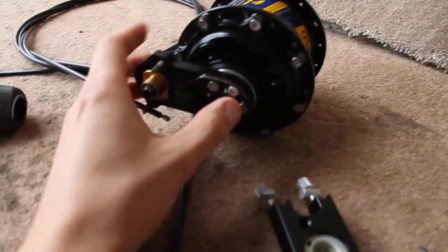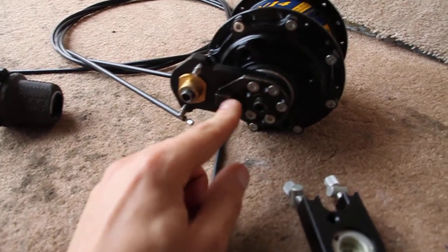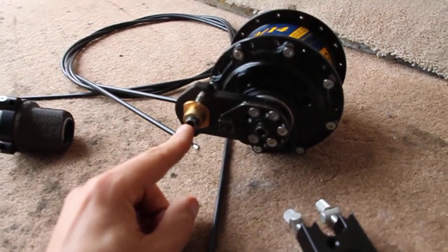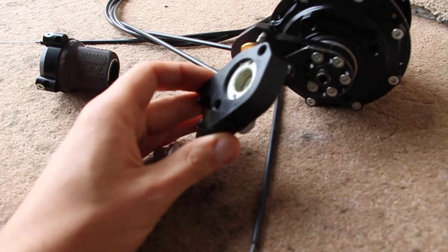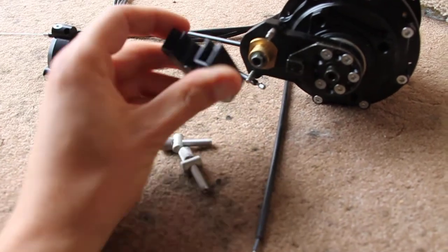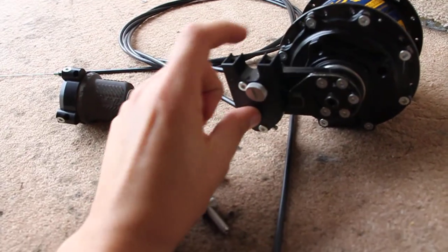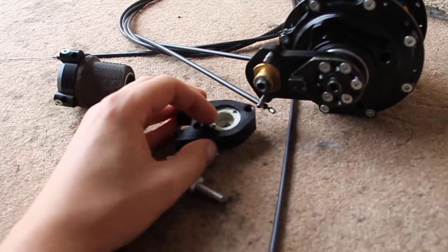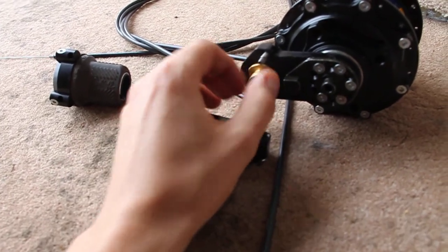This is the gear changing mechanism part. This bit fits in the frame and this bit also slides in to hold it in position. This little part here is what the gear mechanism links to, with this section here. It's got the little hexagonal bit in the middle which slips over here, fits on like that. Then you have the two cables coming out here and here to change gear, and that spins around the silver aluminium bit inside here, which changes the gear on the hub.